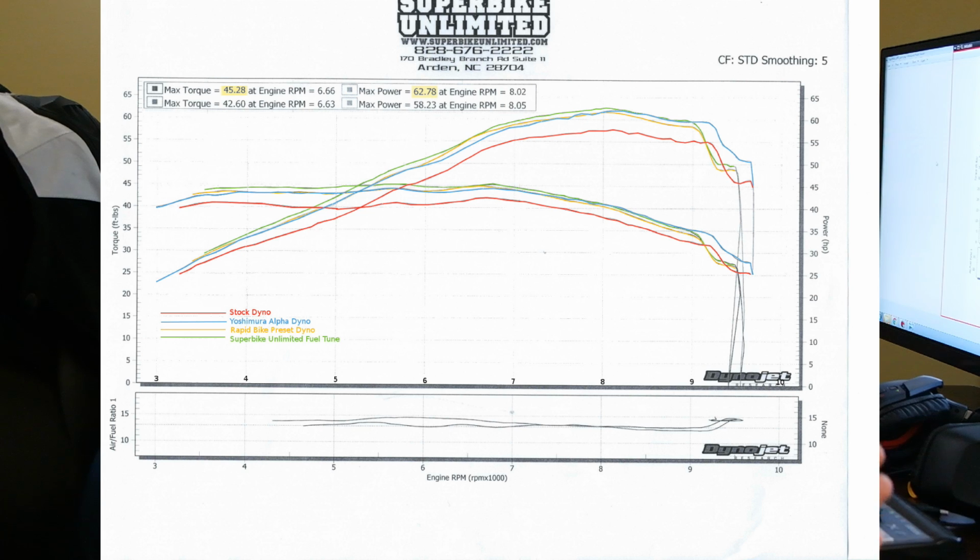And this is only part of the journey that I'm on with this bike, so we will be pushing this bar on up. Like I said earlier on the ride video, my next step's probably going to be doing a sprocket chain kit, the 520 kit, and some new grips. Definitely want some better tires. And what that chain kit's going to do is reduce a lot of weight and gear it down, and you're going to see upwards of a 10% increase in the torque on this bike on the lower end. Now, I probably will lose a little bit of top end.